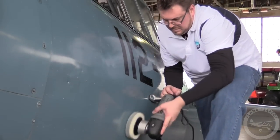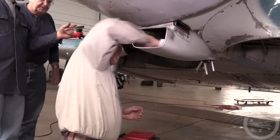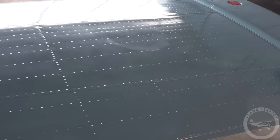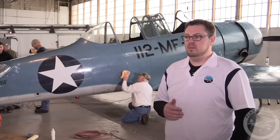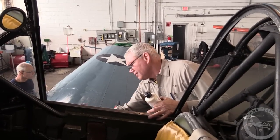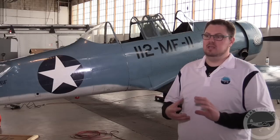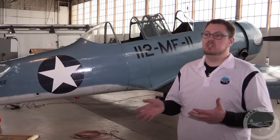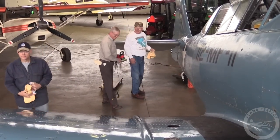After that 20 minutes, you go ahead and apply a second coat. The reason for a second coat is to ensure a very even application. With any high or low spots or buffing marks — and in this particular paint job, which is over 40 years old, the paint is very thirsty, dry, brittle, and cracked and chipped in a lot of places — it really wants to soak up that product. So we do a second coat: same process, apply it, wait 15 minutes, then buff it off by hand or with a random orbital. Perfect Seal is a nano-spec technology, polymer-based, and it actually bonds to your paint on a molecular level — a fast-acting, rapid-bonding technology that bonds into the paint rather than just to the top coat. It softens up the paint, and after the 15-minute wait and buff-off with the 20-minute cure time, you can actually see the paint rich and deep in color, like looking into the deep end of a swimming pool.